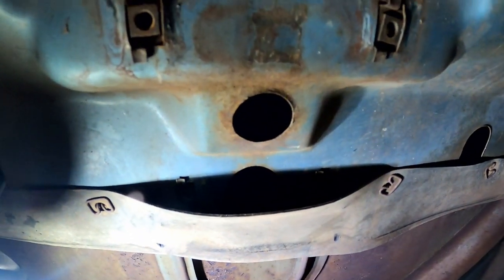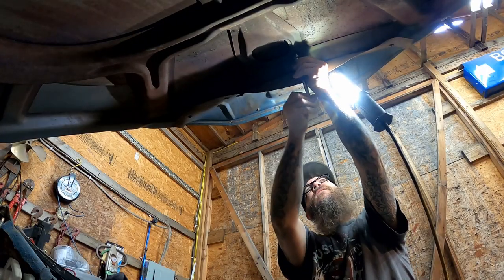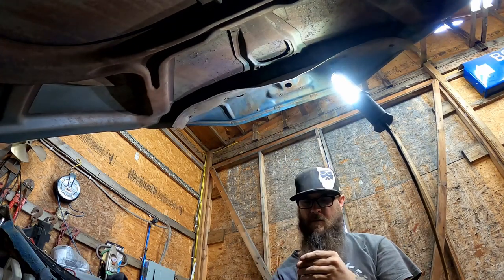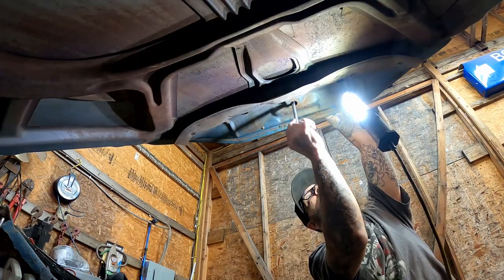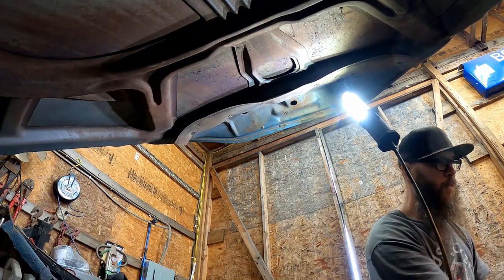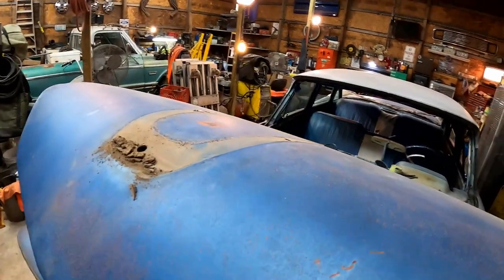With the latch out of the way you can see that third hole. There is a bolt in there, so let's get that off along with the other two. All these have been three-eighths - wait, no, seven-sixteenths. That's the last one. It's just hanging up on the threads a little - there we go. And there's some more crud.